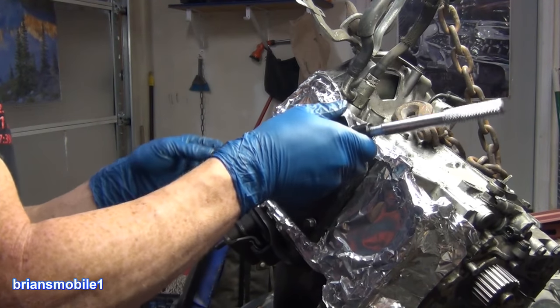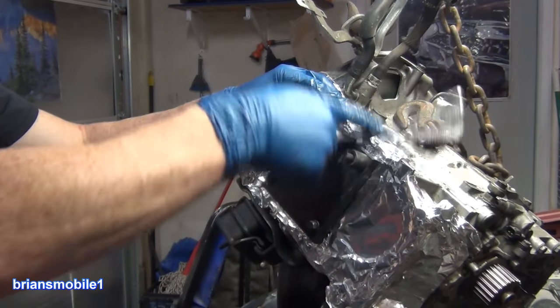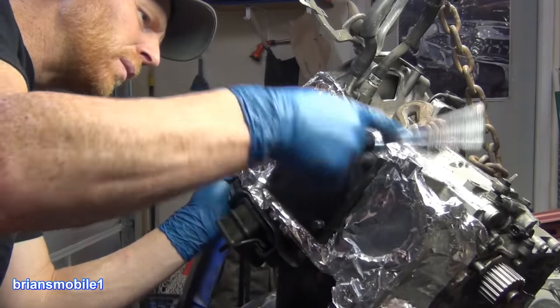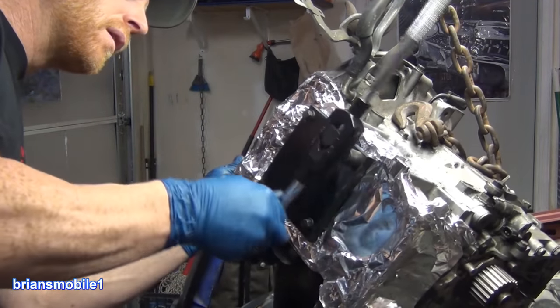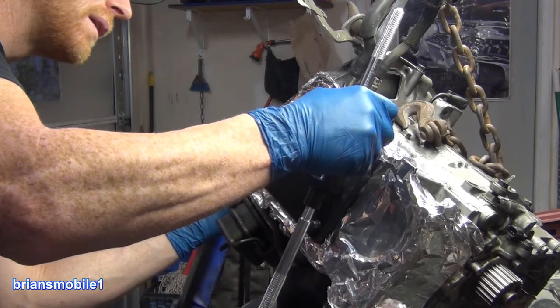I'm gonna just send that down in there. We've cleaned the hole. There's no oil in it. Went to our mark. And we're just gonna send her in. It should go bump, but we're gonna watch that black line. It's starting to get hard. It's going to come up short. It hit the shoulder is what happened. It just hit it right there.